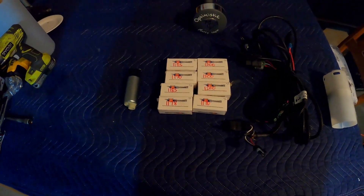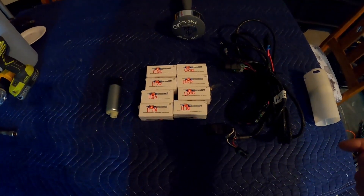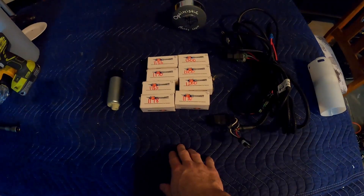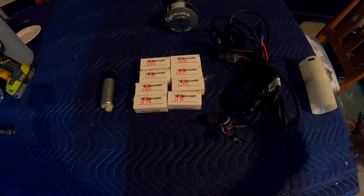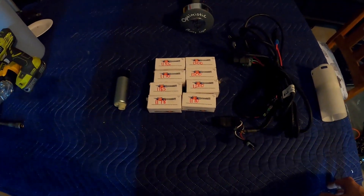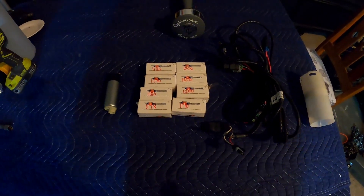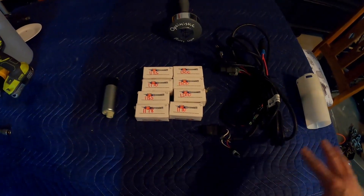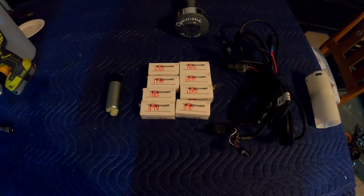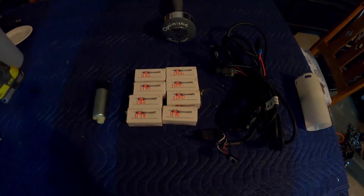A couple of hours and you should have this ready to go. It is important to note that if you do install this, especially the injectors — I probably wouldn't install the injectors up until you get close to a shop that can tune your car, because your car most likely will not run very long with large injectors. What I did was install my fuel components first, and then when I got to the shop, I installed the injectors. Just a little warning to save you guys some time.